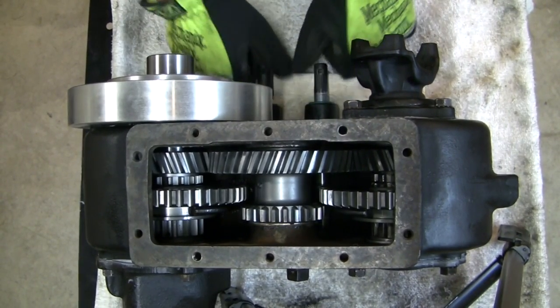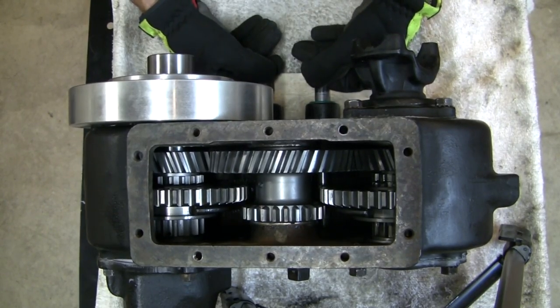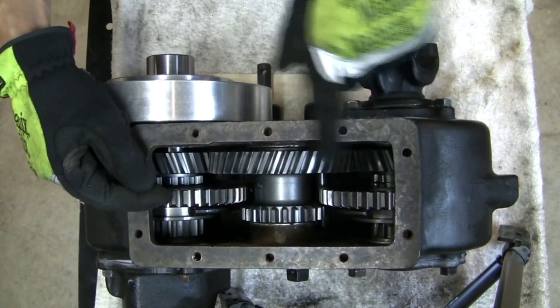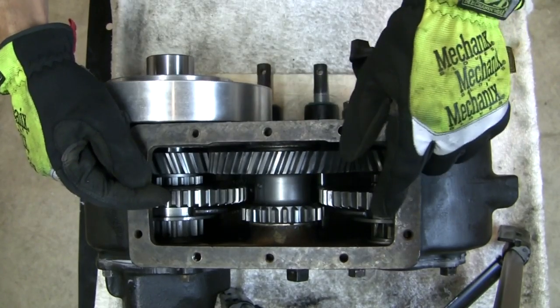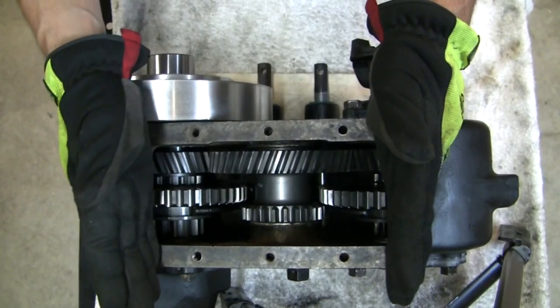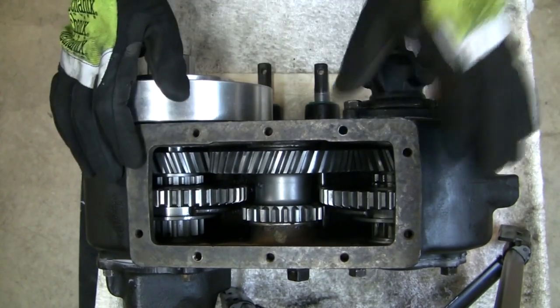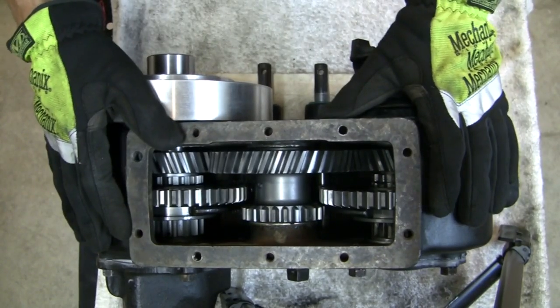What I'm going to show you here is that the work done on the shift rails is successful in enabling independent operation while still keeping a measure of interlock between the two output shafts, so that you can prevent undesirable combinations of gears — for example, one half in high and one half in low, which would obviously nuke the transfer case.